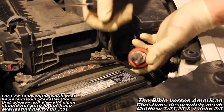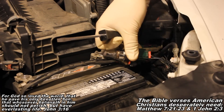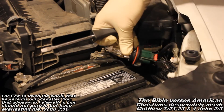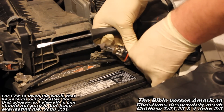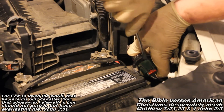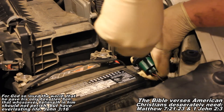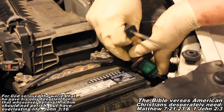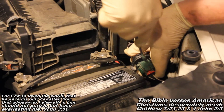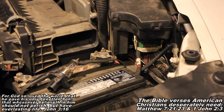The next thing you want to do when you've got your bulb exposed is you want to turn it around and find your red little tab. Now you can either take your fingernail and reach in there and pop it back, or you can take a flathead screwdriver and kind of wedge it back there. When you do that, you'll be able to begin trying to remove your plug. The easiest way to do this is to take your flathead screwdriver, just get in there and kind of pry them. Come around to the other side, reach in there and keep prying, and then come around to the front and pop them off. Now you'll just be able to pull it off. That's the way you go about removing your plug.